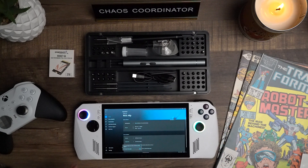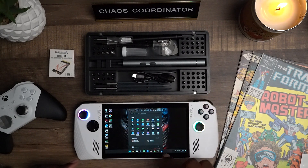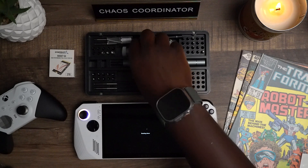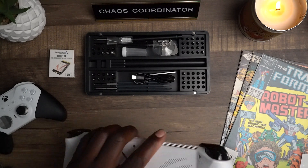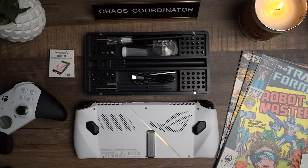Now that we're updated to 319 — in my case I'm already there — we're going to go ahead and power this device off. Shut down and boom, system is shut down. The beautiful thing about this ROG Ally is it is extremely easy to do this. No matter what your PC knowledge is, we're basically going to be taking out five screws. The sixth screw does not come out and is not necessary to remove, so don't be in shock if it's not coming out.